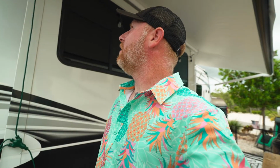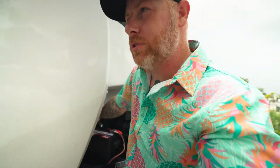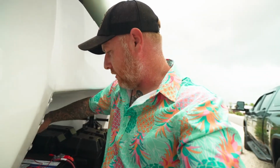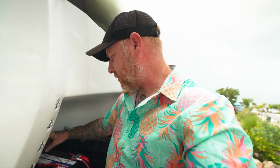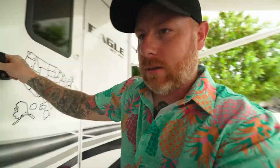I'm not really sure how to deal with the motorized awning that won't go. Let's see if we can find out. And of course, I can't just turn off the breaker and the master 12 volt switch because it's still getting battery power. The controller for all the accessories, so I have to literally disconnect the battery to try to kill power altogether to that thing. I mean, I'm just starting with simple stuff, right? It's like your phone or a computer. It starts acting up and doing dumb stuff, just shut it down, restart it, try again.